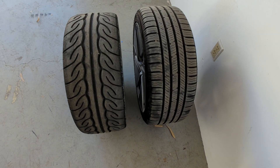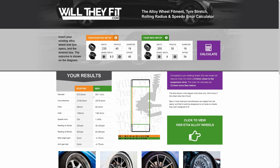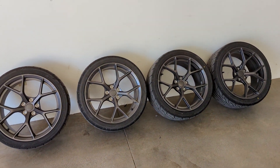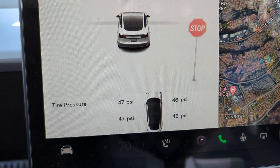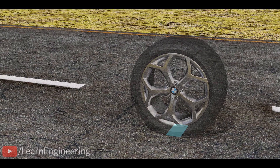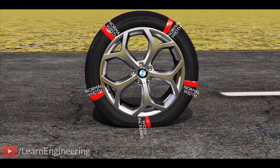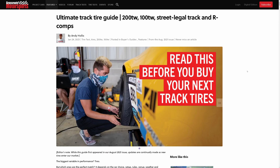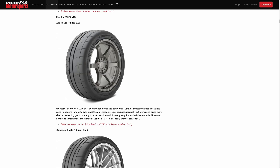They're noticeably wider than my eco-focused 720 treadwear Nokian 1 all seasons and slightly smaller in diameter as well. While you don't need to get TPMS sensors for your extra set of wheels and tires, I recommend it just so you're not constantly reminded by the car that they're missing, and being able to monitor your PSI is a plus. Lowering your PSI can improve traction by increasing your tire's contact patch — 32 PSI seems to be the sweet spot for me, but it may be different for you depending on your wheel and tire setup. For a great guide on choosing your next set of competition tires, see the link to the article in the description.